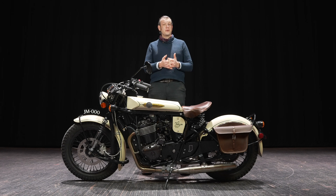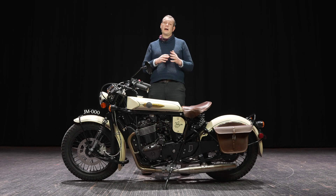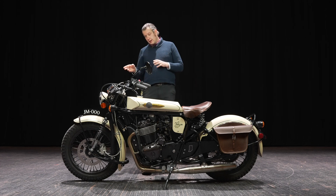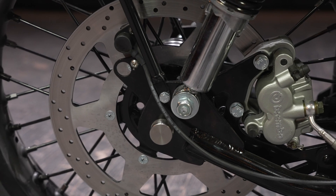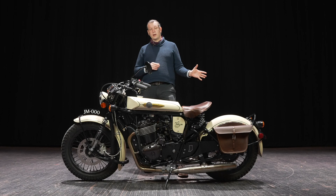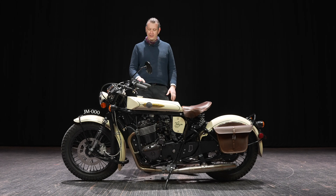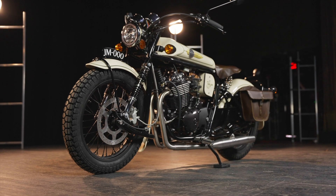One of the other aspects of the bike we really wanted to improve was the brakes. Right from the beginning of this project we have been in conversation with Brembo, an Italian brake manufacturer, probably one of the most famous in the world, used in many industries including racing and automotive. We are using their two-piston caliper in the front and a single piston in the back, just like the 250, but increased in size. The front rotor is 280 millimeters with a twin-piston caliper, and the rear is a single-piston caliper with a slightly smaller rotor. We are also running Spiegler braided stainless steel brake lines as well as Brembo front and rear master cylinders.